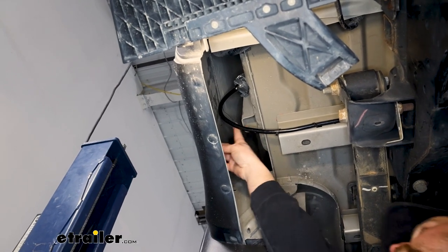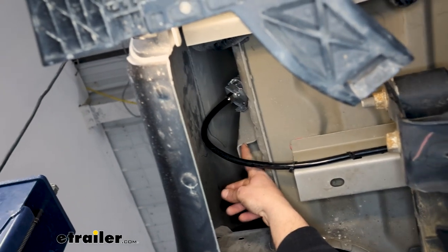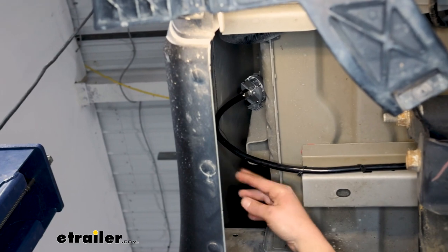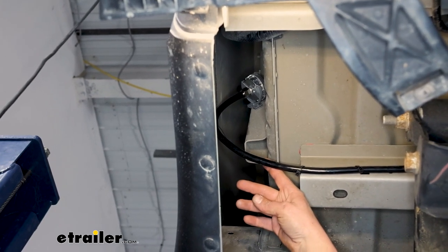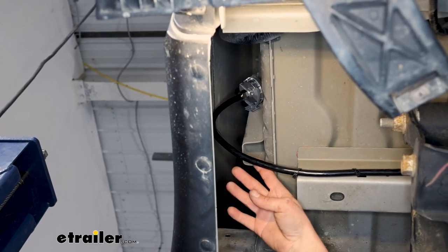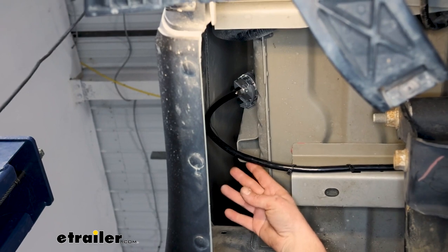I went ahead and mounted up our air filter on the driver's side, kind of behind our back tire and up along our bedside. There's a support — I drilled a three-eighths hole in it and that filter just snaps into place. Then take your line, cut it to length, and just push it right over the barbed fitting. You want to mount this in a spot where it's going to stay dry, out of the elements, and higher than the air compressor so moisture won't accumulate. When you're doing this, you don't want the line to be kinked or pinched at all. If you have a heat gun or a hairdryer, you can put a little heat on it to make it more malleable so you can bend it and form it how you want it to route.